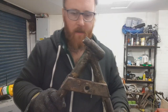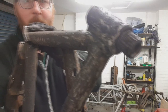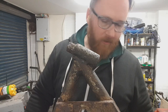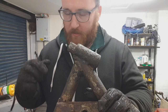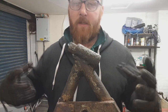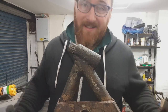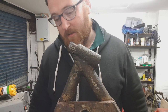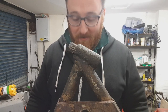We may be close to admitting defeat here with these toe adjusters in the back. I've mangled the life out of them now, so they're definitely not getting reused. They're seized in here good and tight. What we're going to have to do is flatten this back to shiny metal, weld on a socket, and hopefully a combination of the heat and the weld plus a big half-inch breaker bar should break this free. If this doesn't work, I can add £150 a side for new rear wishbones, because there's not much else that's going to take these out.